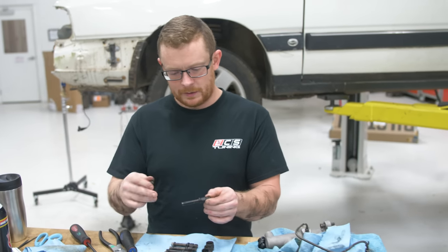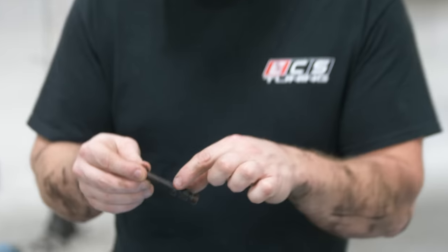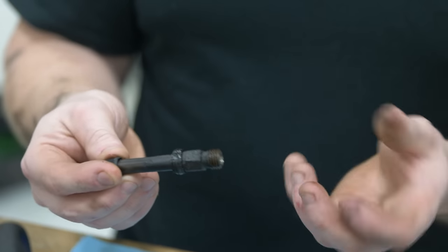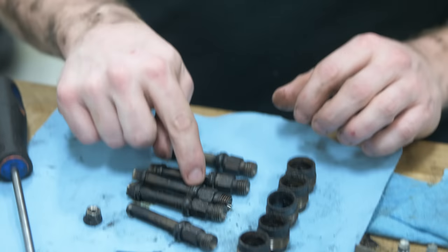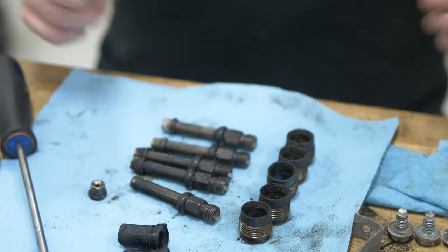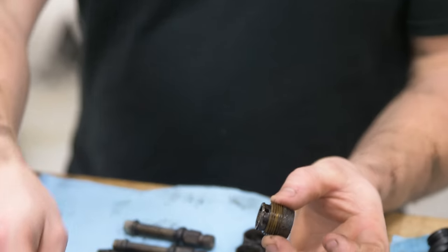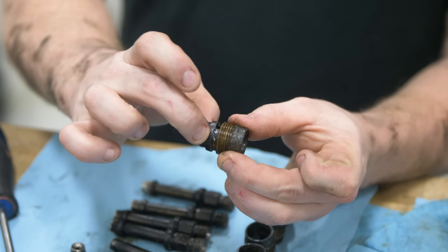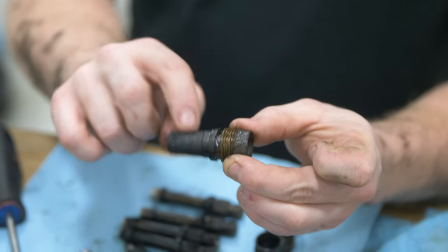The reason I took them out was because there was a leak on the intake manifold side right here on one of the O-rings. So normally people just take these out and replace the O-rings on this little cap, and that seals up the manifold essentially. So there's these brass fittings, and normally these plastic things right on top of there, and then there's another O-ring that goes between here and the head, and the injector seals on the inside of this plastic.